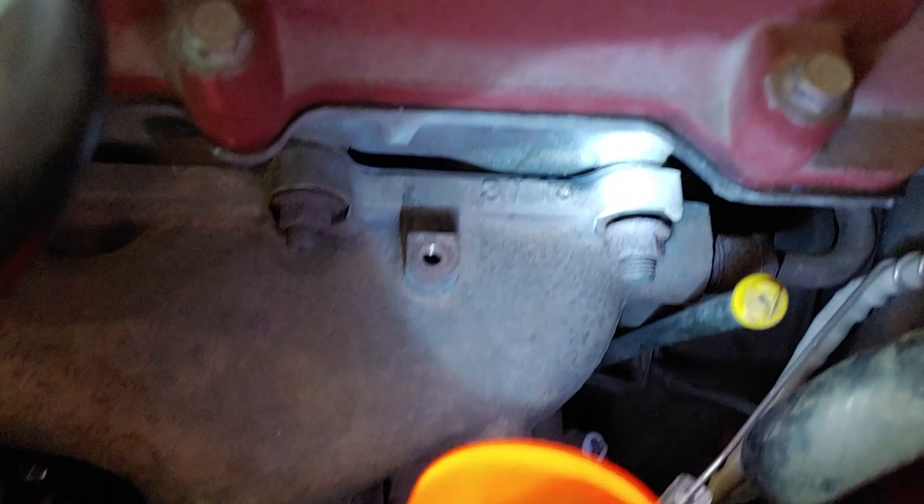It was a little bit loose at that point. I don't want to put red Loctite on there and then never be able to take off my exhaust manifold ever again. But at the same time, I have to pull out a ton of stuff to get to that bolt every 5,000 kilometers — that doesn't seem like a good solution either. Some people had suggested studs. If you've got a suggestion for the type of stud to replace that, put it in the comments. I do have the O2 signal sensor coming from Flying Miata, which I'm going to use to address some of the ECU stuff. I think MegaSquirt is probably in the future, especially because I'd like to do a custom intake at some point, and maybe something with a downpipe and the exhaust.